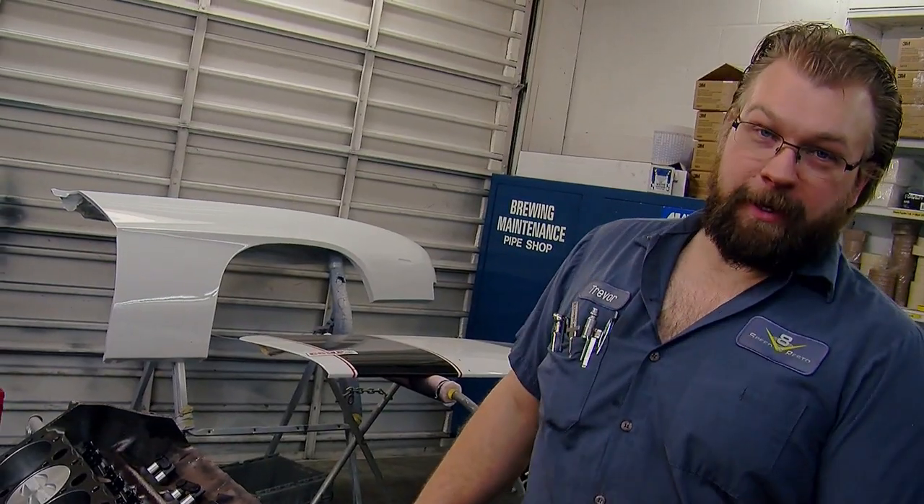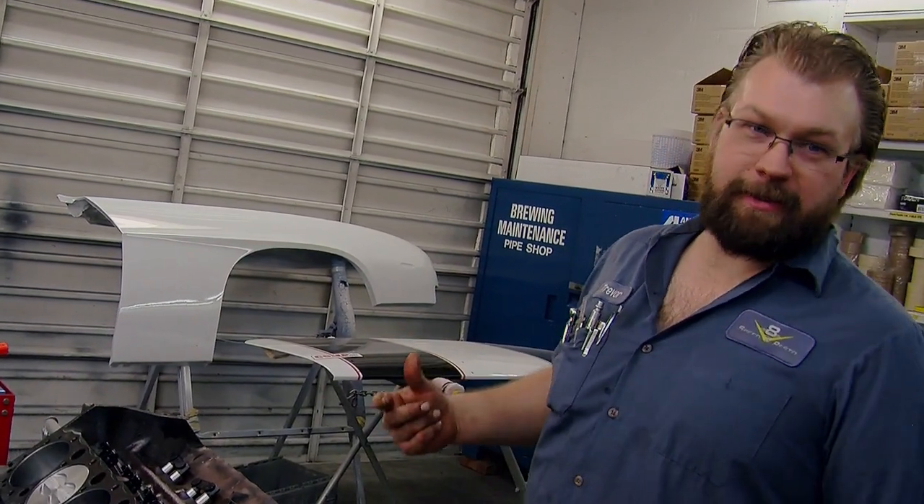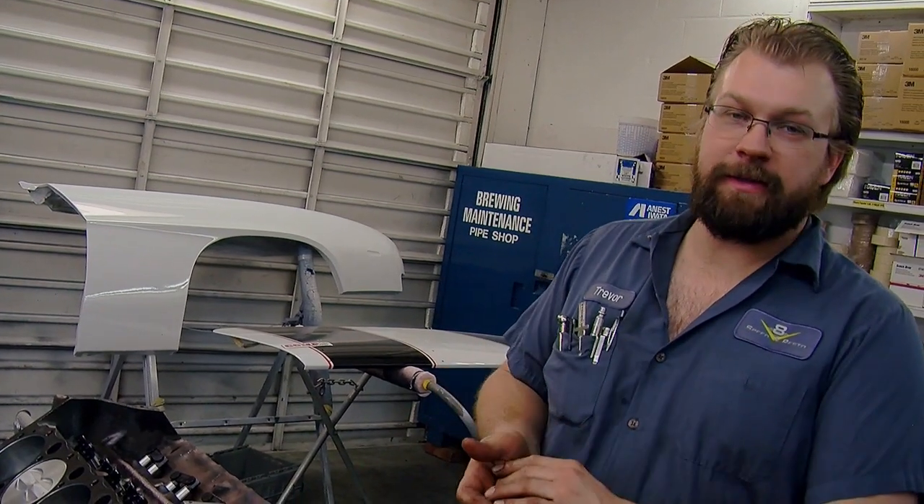Another thing to consider is that we didn't use our head gasket during this check — the head gasket isn't supposed to be torqued down more than once. Some people prefer to put the head gasket in and calculate how much crush there will be on it; I prefer to work the other way so you don't risk damaging the gasket. We'll add the compressed thickness to our measurements. Any gasket manufacturer publishes compressed thicknesses for their head gaskets, which you can also use for compression ratio and quench area calculations.